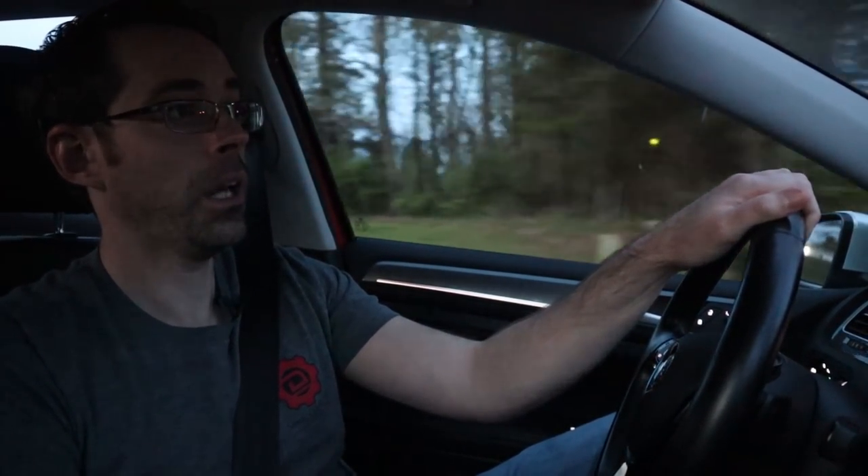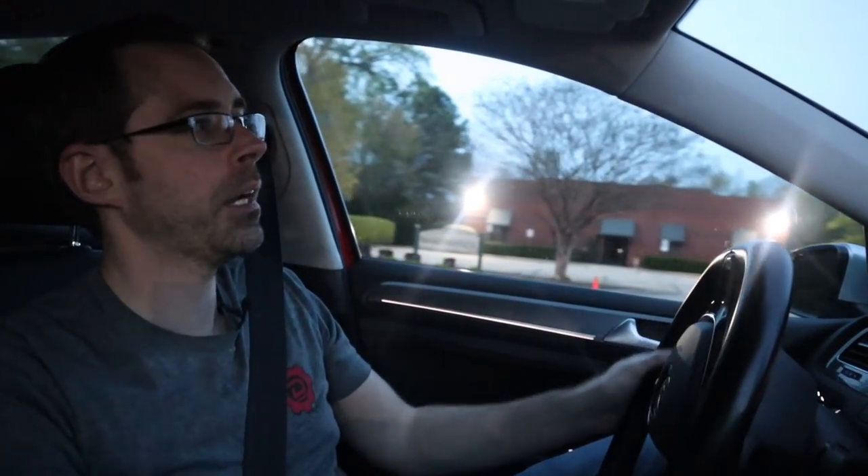Here's something I think people are going to have a tendency to consider that I would highly recommend against: do not drive around with your Haldex on 24/7. This is something that's purpose-built, and I wouldn't recommend having your Haldex engaged 100% of the time because it will certainly reduce the life of the pump and potentially the Haldex clutch if you're constantly having it on. I just think some people are going to get this and leave it on all the time — that's not really how it's intended to be used. So that's my number one piece of advice: do not have your Haldex on 24/7.